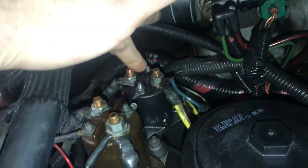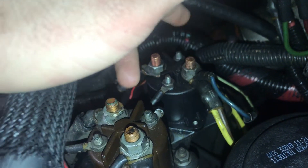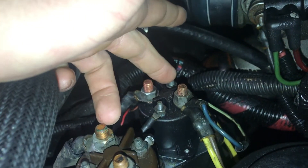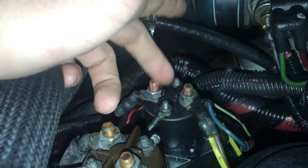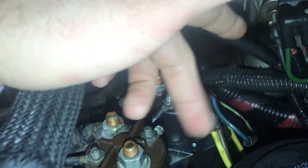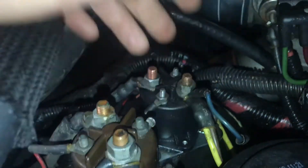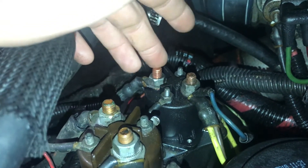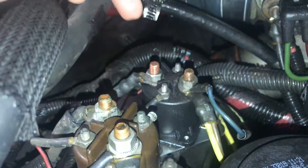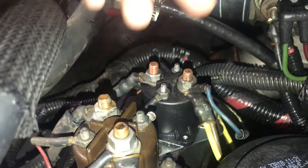Come to find out, if you look here — not this relay, but this one right here — this is your glow plug relay. This is your constant hot from the battery. This is your feed. I think this one is your line from the PCM, and this may be a ground. Not exactly sure on those two. But I know this is your constant battery feed, 12 volts, and this is the feed that goes to the glow plug harnesses themselves.